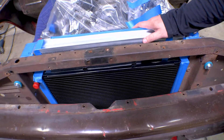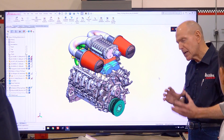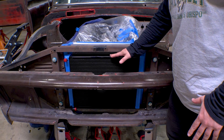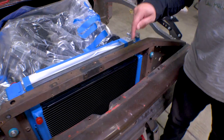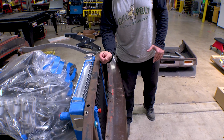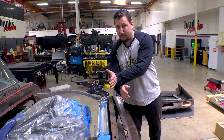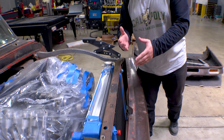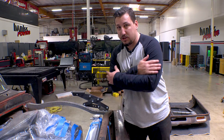We've got a couple parts. The radiator is already in and mounted. This other heat exchanger is part of our supercharger system. In the manifold we have a charge air cooler known as a CAC, and in front of the radiator we have a low temperature radiator or LTR. We're going to mount the LTR and the air conditioning condenser, stacked in this order: radiator, LTR, condenser. We get a very small amount of heat rise through the AC condenser and good AC performance if it sits all the way in front. If we swap that with the LTR, we get a large heat rise through the low temperature radiator and our air conditioning doesn't perform as well. So we're going to take a little bit of a hit on the air temperature going through the LTR for the supercharger system in order to be nice and chilly in our cab.